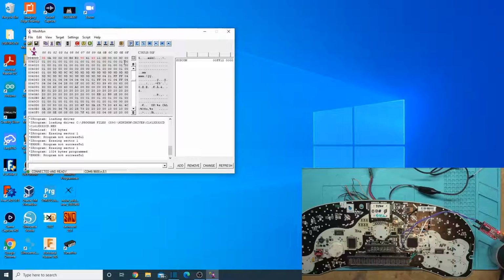And so then I tried another random one, and had problems with it too, and I knew I hadn't programmed on there. So I was like, okay, there's something going on with the boards, because this one has a new microcontroller and the other one has an old microcontroller. They're both doing it. So I think it's a problem with the board. I think it's either voltage regulation or clock. I don't know. I really don't know. But they're not stable. So let's go ahead and give it some heat and see what happens.